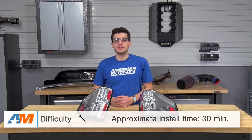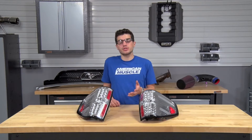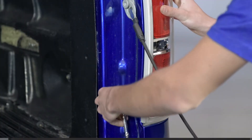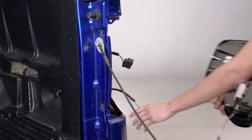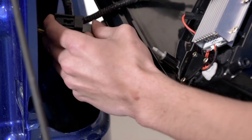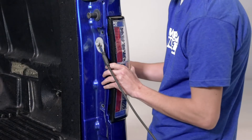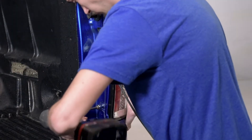The installation will be extremely painless — something very straightforward that you can get done in a little bit of time in your driveway. The only tools you're going to need are a ratchet and an 8-millimeter socket. Start by dropping the tailgate and removing the two 8-millimeter bolts that hold on your factory housing. Once the bolts are off, remove the factory housing by pulling it away from your vehicle and setting it aside. Then pick up your aftermarket set, test the connections by plugging them into the vehicle's wiring harness, turn your lights on, and make sure all of the LEDs are working properly. Once confirmed, take the white reverse light out of your factory housing and put it into your aftermarket set, pop them back into the vehicle, reinstall those two 8-millimeter bolts, shut the tailgate, and you're good to go.